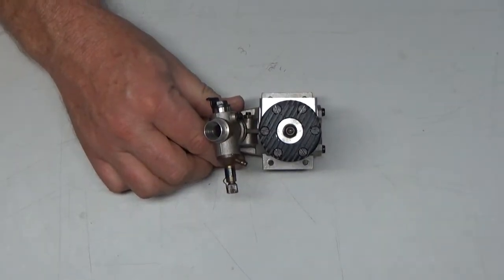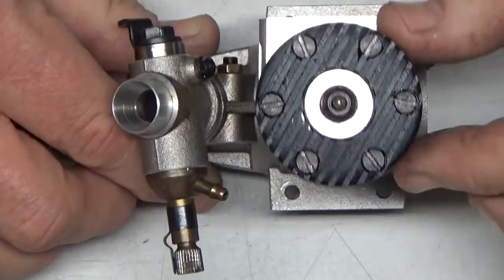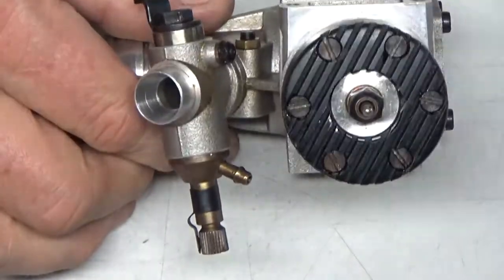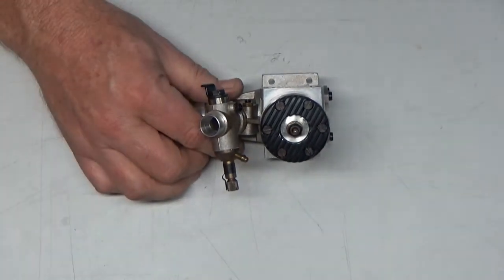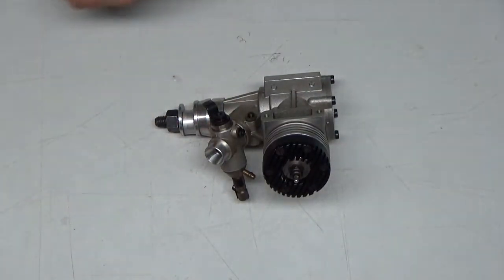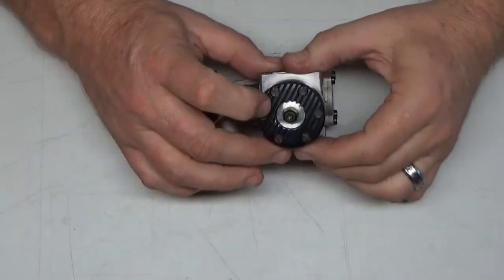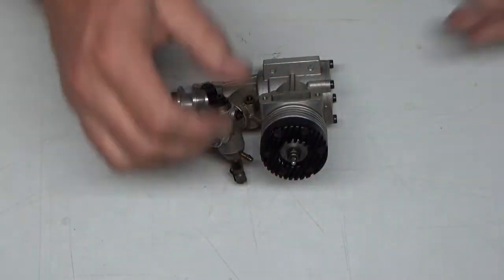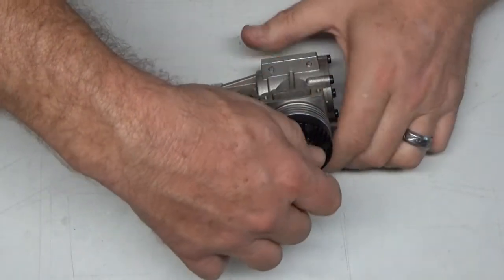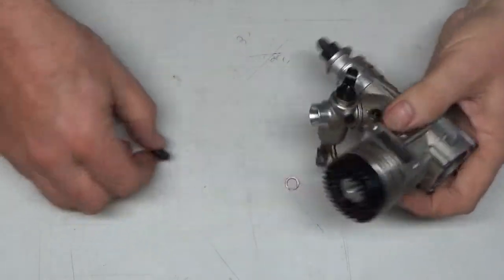You might say, what's going on with the head here? The head fins aren't lined up properly — I noticed that in the ad too. That's why I'm going to take the head off and look inside, and also pop the backplate just to confirm my suspicion that this has never been run. Obviously Rossi would never ship an engine with the head in that orientation, so somebody's been inside this thing — and that's a little concerning.